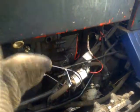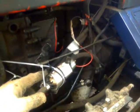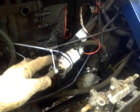But as the fuel goes to a higher temperature after the return from the engine, maybe on a day in which the temperature is higher, the fuel comes with a higher temperature, and maybe the pump cannot deal with all that heat. So it seems like it helped.